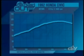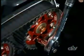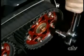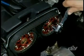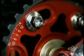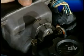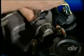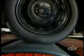Without any further tuning, the new cams improve the horsepower curve above 6,000 RPM. Once the baseline is set, you can adjust the cams by loosening the cam gear adjustment bolts and turning the cam bolt while the timing belt holds the gear steady. On the B18 Honda engine, each time you adjust the intake cam timing, you'll need to reset the ignition timing because they're directly connected. After the timing is set, you can make another run.